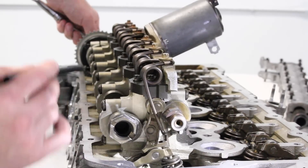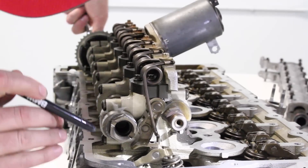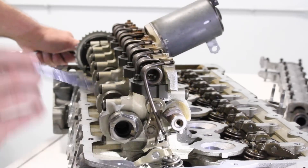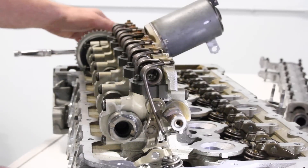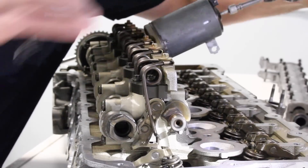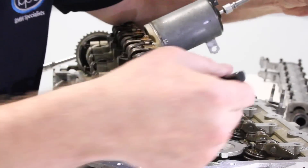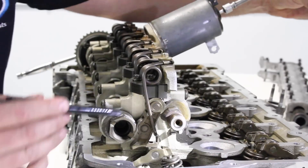I'm going to rotate the cam at minimum valve lift. Right now we're on base circle, coming up to max lift. The valve spring itself barely moved — actually it moved 0.18mm at minimum lift, which is really not enough to even be seen by eye without putting a dial indicator on there. When the throttle is applied, I have a 4mm Allen that I'm going to put on the back of the valvetronic motor. The valvetronic motor is splined to a gear on the eccentric cam. The eccentric cam has a half circle which makes contact with the intermediate lever.